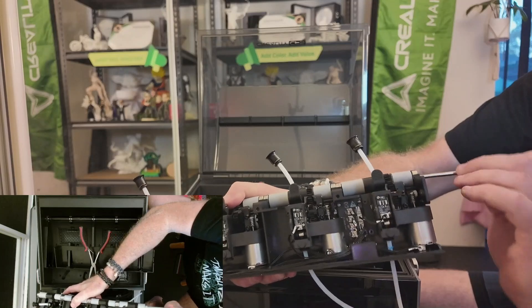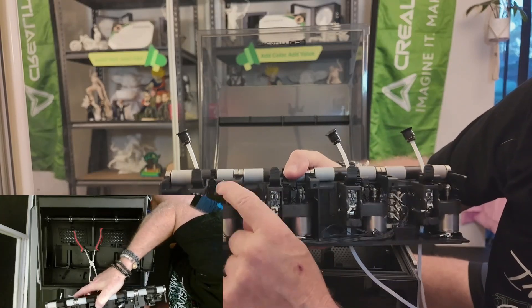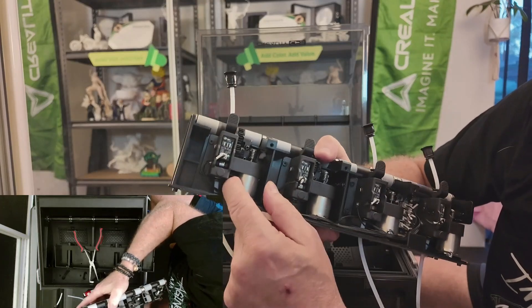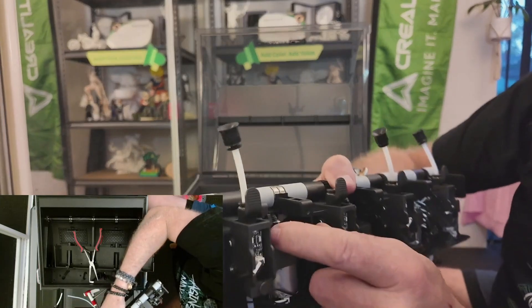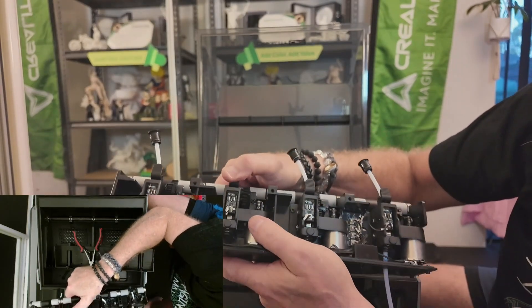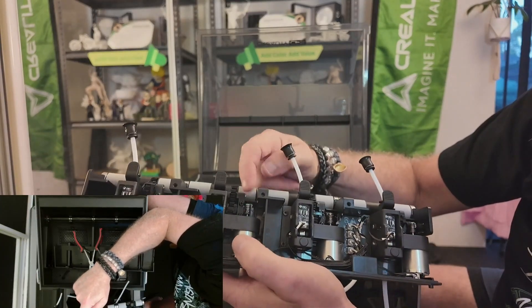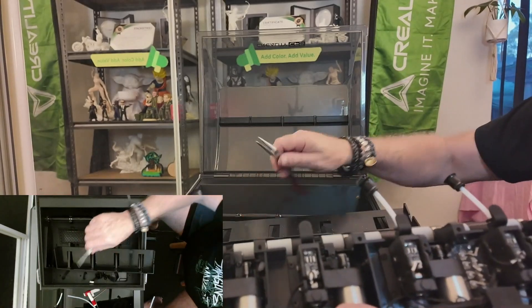That's a training lesson for me too. So that's the inside of it — basically you've got a motor on each one and it runs a bundle of cogs up the top. When it's up it engages and spins the top, and when it's down it doesn't engage so the bottom one can spin, which is inside here. That engages the top pulley mechanism — there's a little switch. These things here are the release so you can release the filament. It's a few cogs and a little mechanism that pulls up and down to engage the wheels or the motor to push filament through.